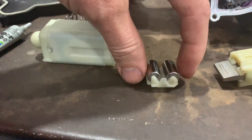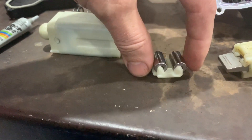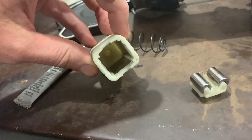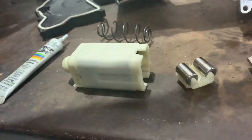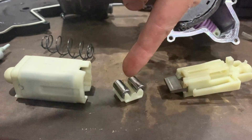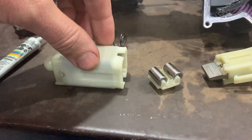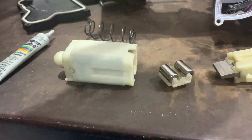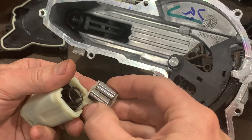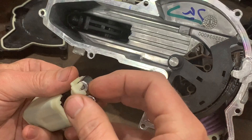See how these two rollers move in and out — basically this wedge pushes between these rollers to move them out. The idea is that it forces those to grip on the side of this square tube. So what it's actually doing is: when the motor pushes on this pivot point, it pushes down on this wedge, pushing these apart slightly, and that grips on the casing of the square tube and pushes this part. That is how that system works. It's actually quite important not to have grease on these parts because we don't want these slipping on the casing.